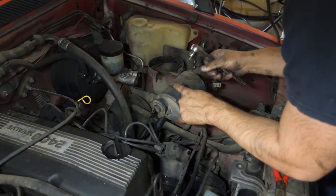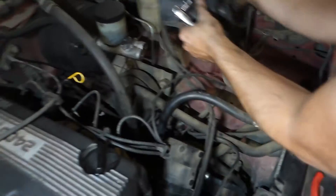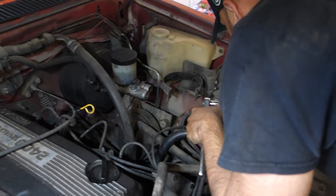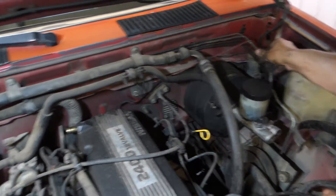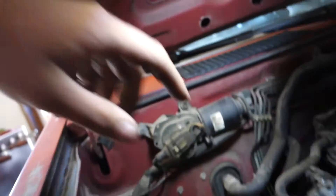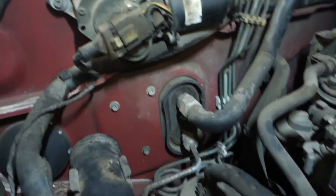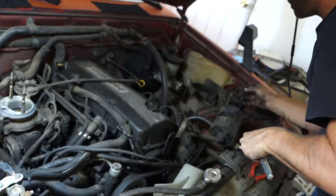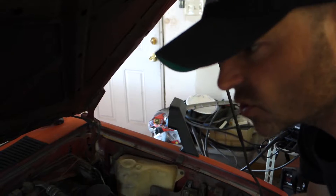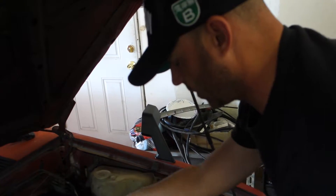Alright, first getting rid of this canister. We got this little thing coming out the bottom that just feeds down into the fender well. We have three vacuum lines coming off the top — one going back here across there and down to probably the gas tank, probably back to the tank. It's this larger one. It looks like it goes down, curves back around and goes back to the fuel tank. We'll probably cut that short and route it back down toward the ground. It was just coming into here and going toward the ground anyway.